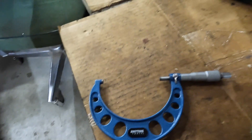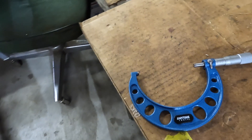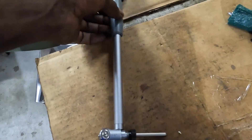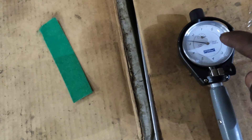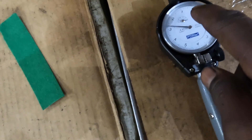The first thing I do is set my caliper to the factory bore maximum limit — 89.02 millimeters. So it's 89 millimeters plus 0.02 millimeter tolerance. I set my caliper to that, then I set my bore gauge so that when I'm at the exact bore dimension of 89.02 millimeters, my pointer goes to zero. That tells me if I put this into the bore and go right to zero, that bore is exactly 89.02 millimeters.